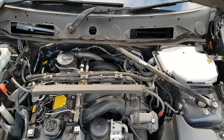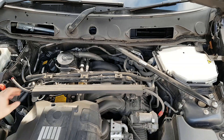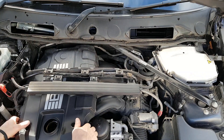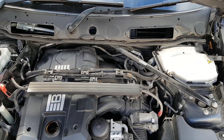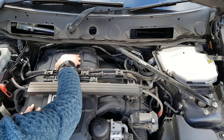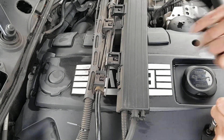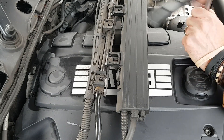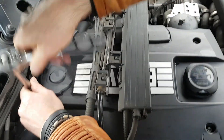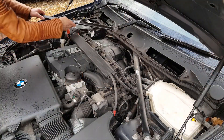Today is tomorrow - I got a text from my daughter this morning and the car started first time, and again on the way back from work, so I'm really pleased. Carly helped me diagnose this, along with checking forums to see if the low pressure sensor could cause long cranking, and the outcome is great. To reassemble: undo the oil cap, push the cover into place, refit the oil cap immediately, then replace the three allen bolts - that's the engine cover back in position. Between this and that I ran the car during diagnostics and made absolutely sure there were no fuel leaks.